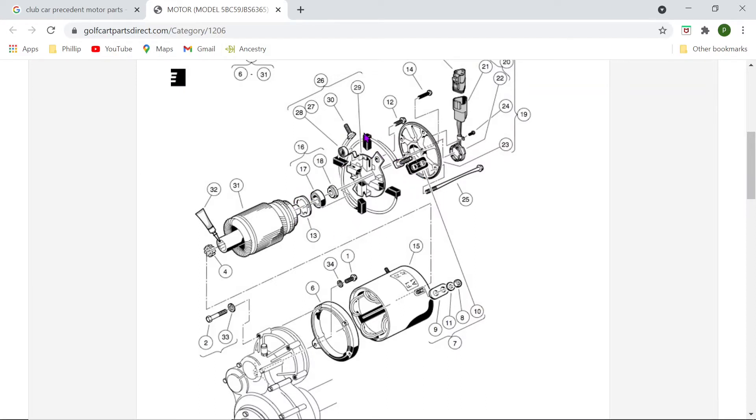I bought a new brush assembly. The brushes and the bearing — I bought the bearing at a bearing supply house for about $7 counting tax. The brushes were about $25 counting tax. So grand total I've got about $35 invested in this repair. Put everything back together and it works. Please follow the video to see what I did, and how — if you come into this kind of problem — you can stop before you break everything, go ahead and change out your brushes. As long as your commutator is in pretty good shape, you don't have any problem at all.